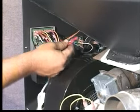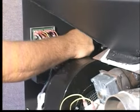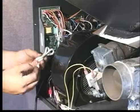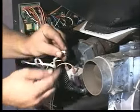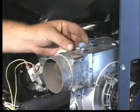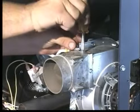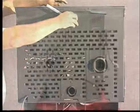plug the leads from the power cord back into the auxiliary control board. Fasten the control boards back to the side of the unit. If you replaced the main control board, place the new thermal sensor lead on top of the exhaust coupler where the old lead was and screw in with a 5/16-inch wrench or a flat-tip screwdriver. Replace the rear cover plate and side access panel.